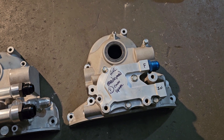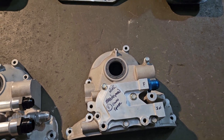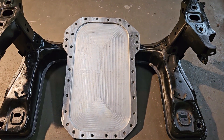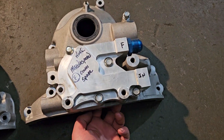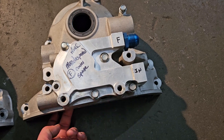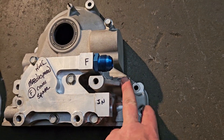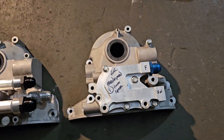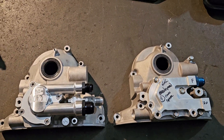So if you have one, it's a great thing to have. It allows you to run a completely flat pan on the bottom of your motor. If you're running a subframe — this happens to be a three-rotor setup — you can basically put that pan right on top of the subframe, which makes for really easy mounting configurations. All of the oiling is done via internal tubes. You've got your scavenge tubes, two of them on the backside here, that would run down the bottom of the pan, then out to tank from those scavenge lines, then back in from tank, and then your feed that would go back into the top of the motor.